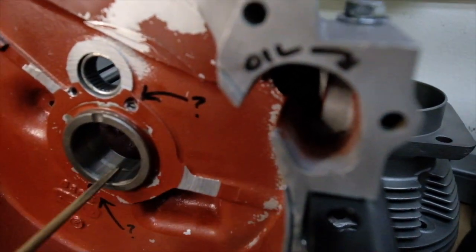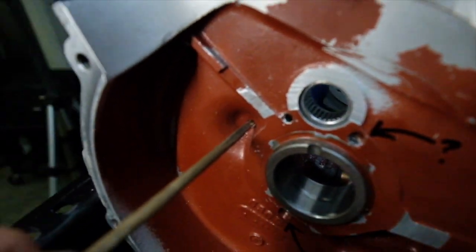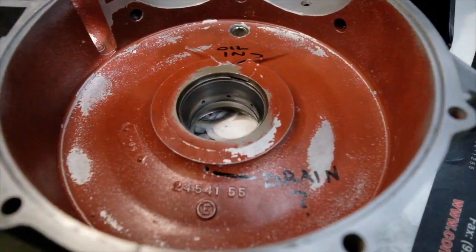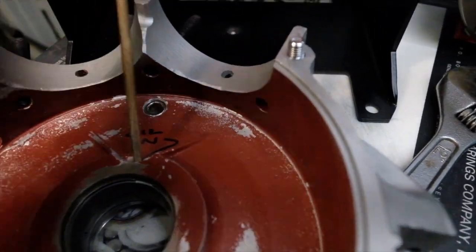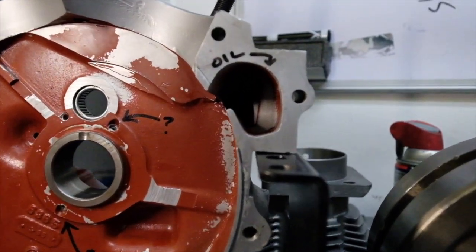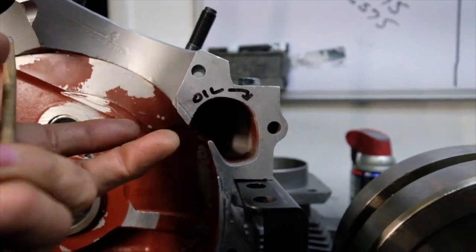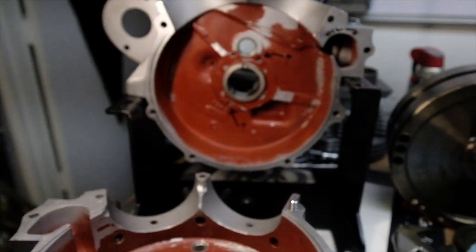There are a couple of threaded holes with set screws - those are bearing retainers helping to hold the bearing race in place. I had removed, cleaned, and reinstalled them with Loctite. This here is the camshaft needle bearing which I just replaced. This hole is actually a reverse thread for the screw that holds the axle. On the opposite end, there's a V cast into the case that also helps oil fall into a hole there, lubricating that bearing pack. Oil then returns to the bottom through a small hole and falls into the bottom of the case. That raised section rides close to the crankshaft and as it spins, guides oil into the chamber that connects to the breather valve.